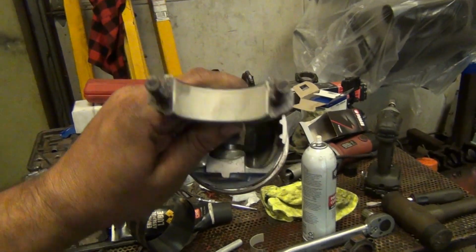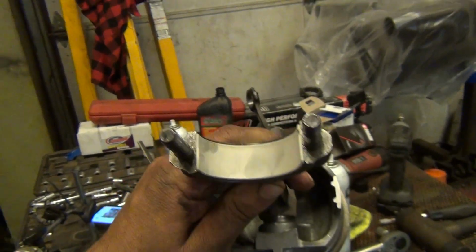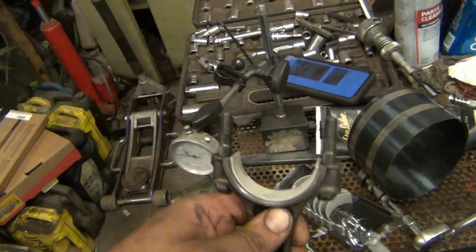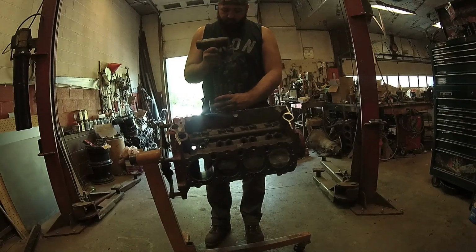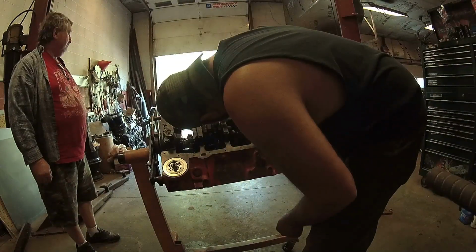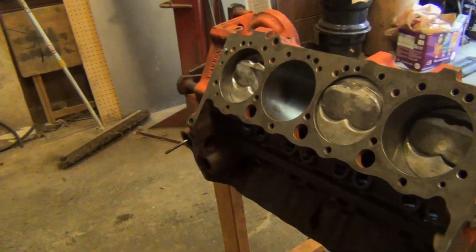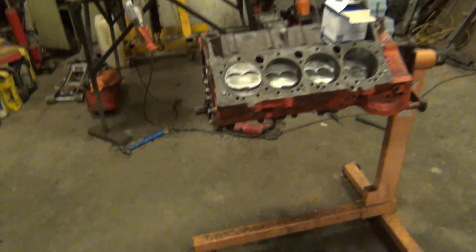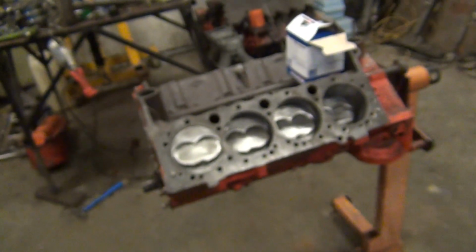All right, fixing to put the rods in. But there's a rod bearing, so it's got narrowed for the fillet radius. Forged crank. And these are coated bearings. Good bearings. Getting her together. All right, this is Mark Oster's 283. Bottom end is together.